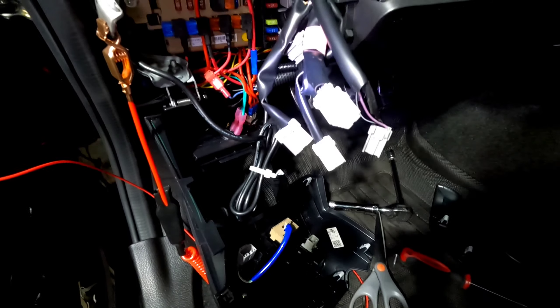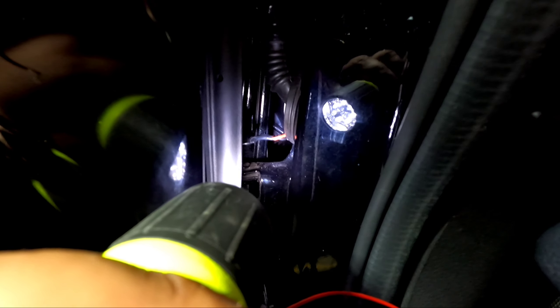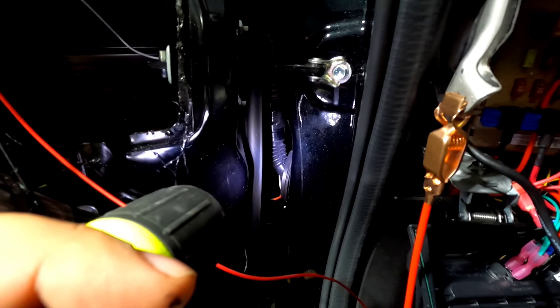Guys, if you don't have a good memory, please take a picture so you know where everything goes. That gray cluster right here — you don't even need to really take it out. There's a pink wire with a blue stripe — I pulled it out for you — that's what you're tapping the black wire to, as per them. And see that red wire right here running through the door? That's how I told you this is going to be very easy for me, because I already have something hooked up to that seat heater fuse. All I gotta do is tap that red wire into the other one, and tap the black into that pink wire with the blue stripe.